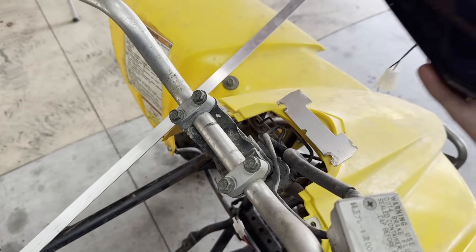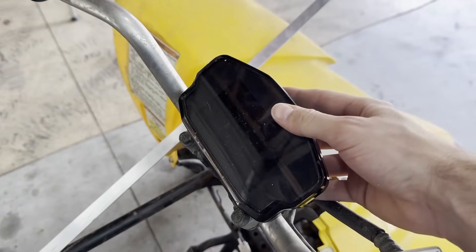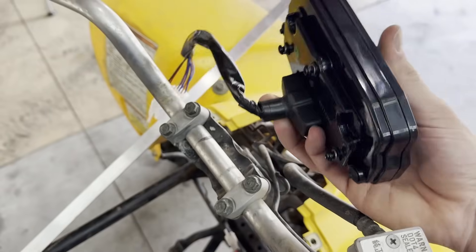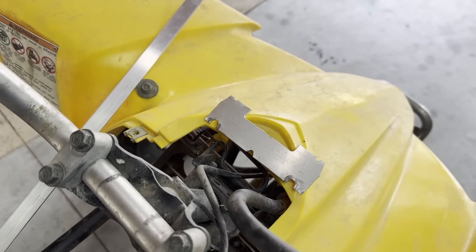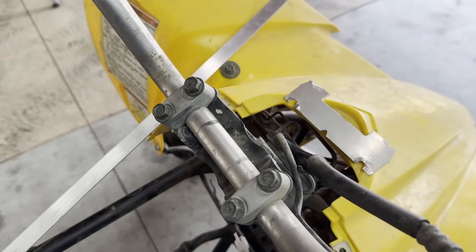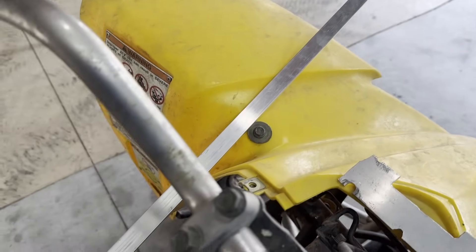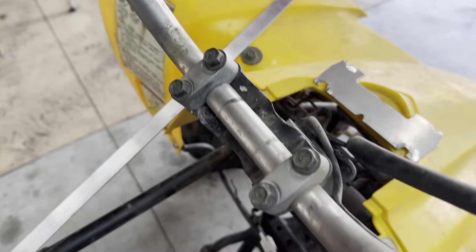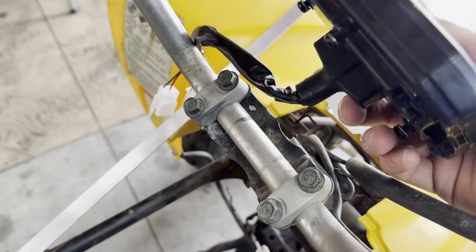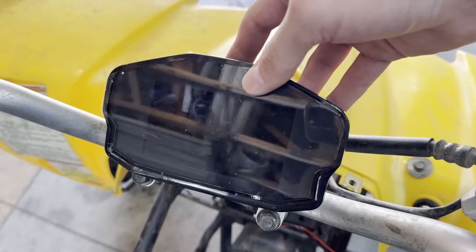Next, it's time to install the display. This is a DKD display that came with the motor kit, and it fits really nicely right here. My first design was a one-piece aluminum that would clamp on the top two bolts and hold the screen in place, but it kept slipping out. So for each side, I'm going to make a piece of aluminum that clamps under both bolts so it won't slip, and then the screen can bolt to it on each side. I added some double-sided tape to make sure the screen doesn't rattle at all.